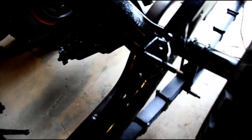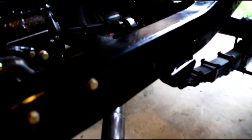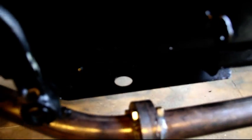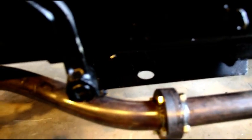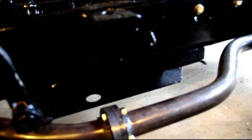And then originally, all exhaust systems were hung right off here. So we'll put another hanger right at this cross member, and that'll hold everything. And it'll be flexible. It'll be able to be flexing around. And then finally, we will put one more hanger right here, and that'll take the weight of all that heavy tubing off of the manifold. We don't want to break the manifold right here or anything, so we're going to make sure that's secured real well. So there'll be 5 hangers in there, and they'll be made out of urethane.